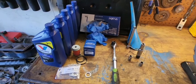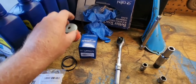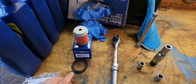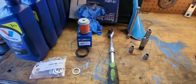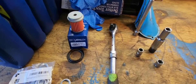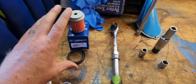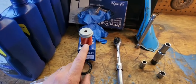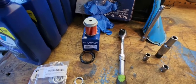Today it's going to be kind of the same thing as last time with the addition of changing the filter element. This filter is not in any of the manuals I've seen or any of the maintenance intervals. It is however on the Acura versions of the CVT, which is the same thing. So I'm going to be changing that today — the only addition is accessing that filter and changing out some o-rings and tightening it down.